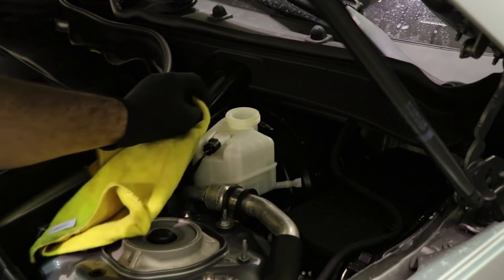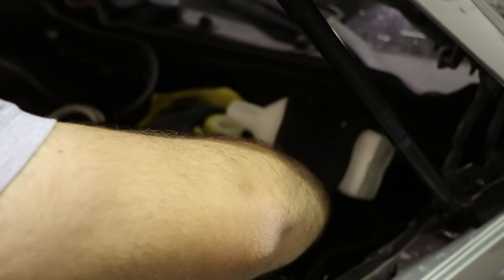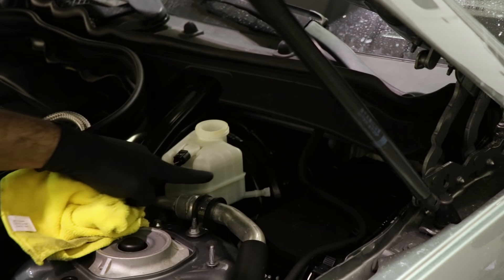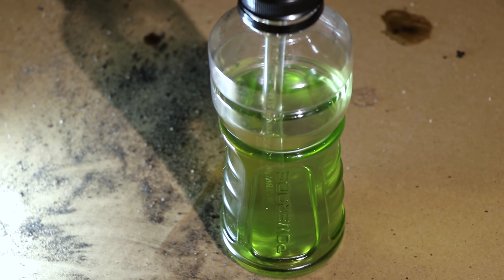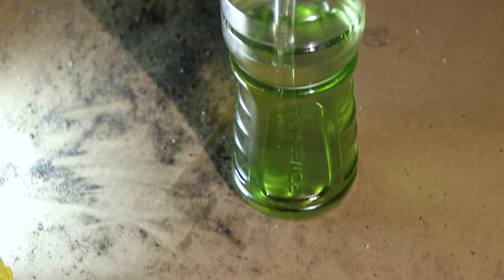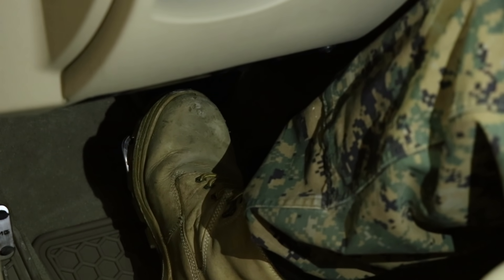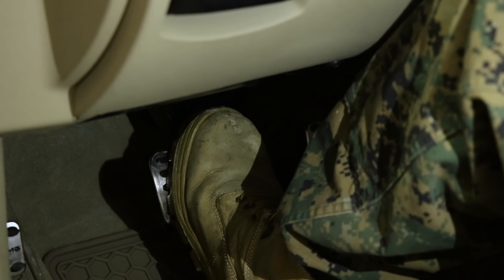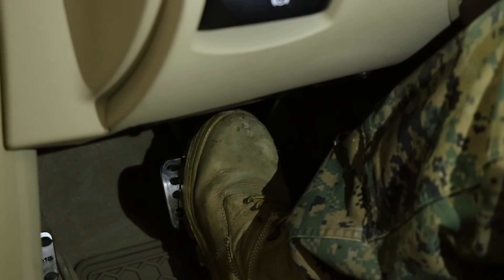Since we're at minimum, I'm going to put a rag around it and add liquid to bring it to maximum. Do it slow because you don't want to overfill and get splashes. Here's how you bleed: put your foot on the brake, push it slowly all the way until it bottoms out, then release and go again. Don't mash on it — use a smooth, nice motion, because if the reservoir burps and brings some air into the mix, it's not very beneficial. It's a long, tedious job, but if you want to pay somebody else to do it, go ahead — I'll probably save that $200.